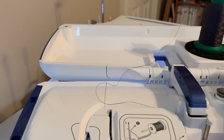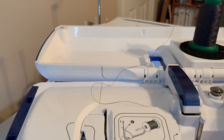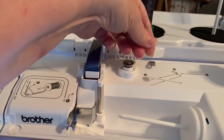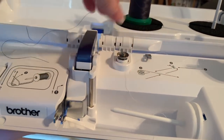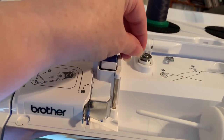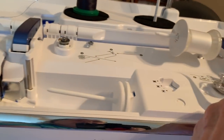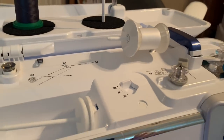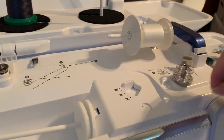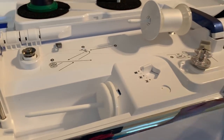Normally folks, this is real easy to do — it's hard when you're holding a camera. So I'll take it through the number two clip. Now what I want to do is follow the graphic. I'm going to bring it around here and over to the bobbin winder and wrap it around: one, two, three, four, five, six — then through the cutter. That's how many times I do it; you can do it however many you want. If I only want it halfway full, I can set it on halfway. I'll go ahead and put it at full.